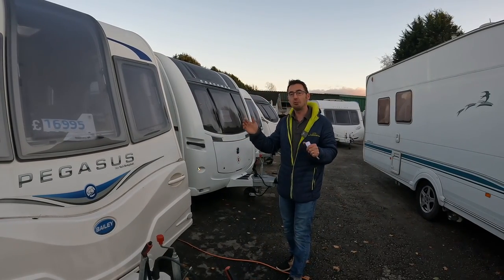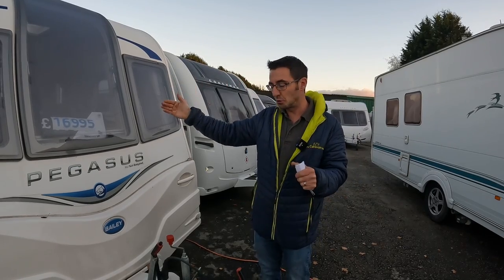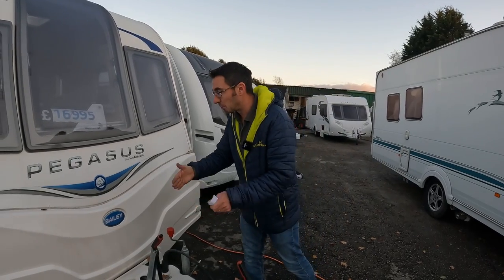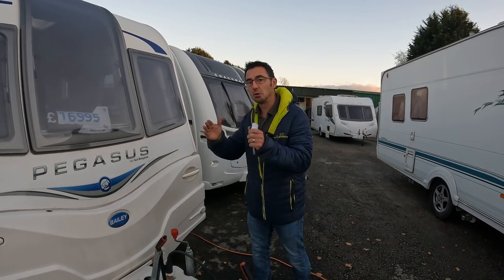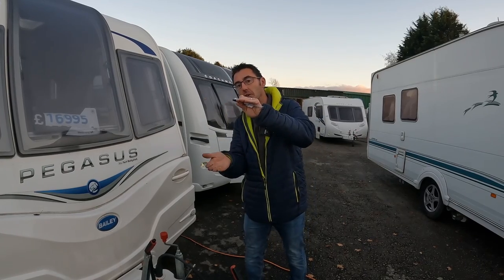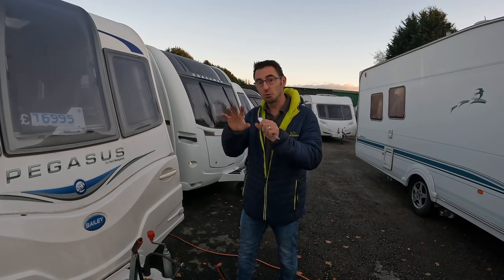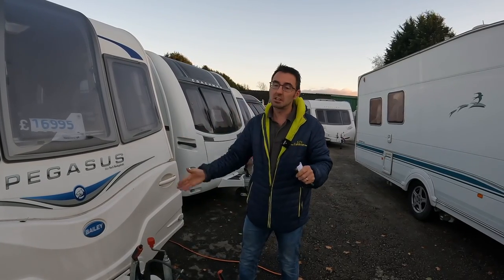It depends where you've parked the caravan. If you've parked it right up against something at the very back it's going to be quite tough, but if you've got a little bit of room — a good foot or two — what you need to do is hitch the car up to the caravan, or put the motor mover on, and actually move the caravan backwards. Because of the overrun device on the caravan, reversing takes the brakes off. By pushing the caravan backwards it allows the brakes to fall off and come unstuck. Going forwards binds against the brakes, making it pretty impossible to pull forward without doing damage to the brake drums or brake shoes themselves.